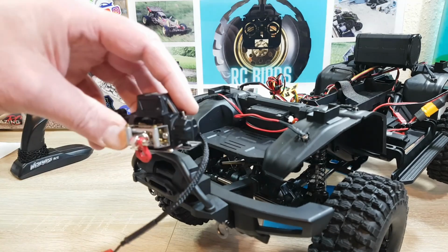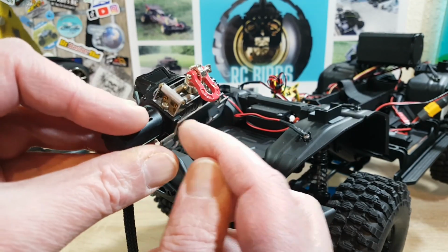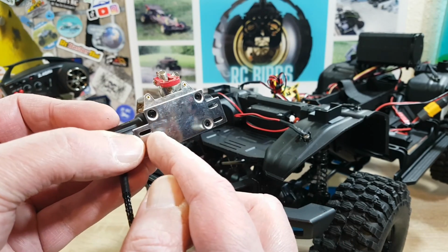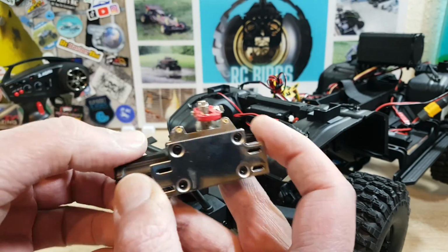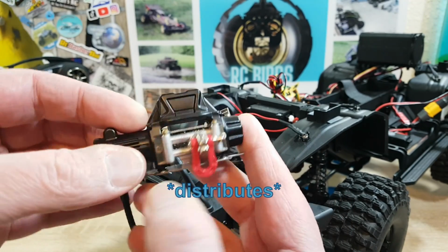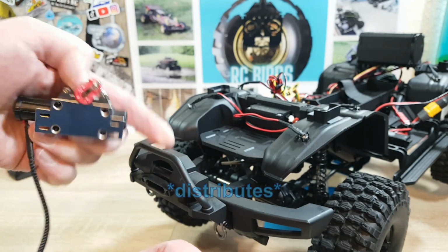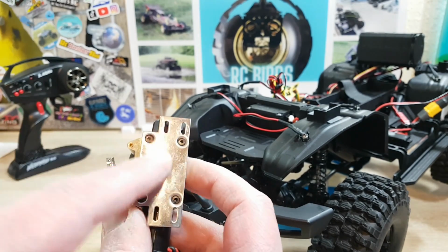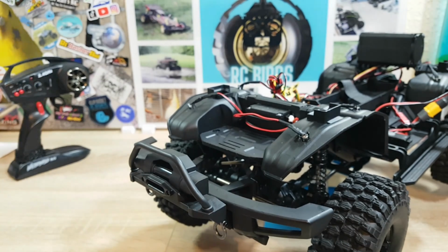on the winch. If you put on the winch, you can for sure use this for screw points and screws here, but I highly recommend to use this plate. It distributes the forces from the winch over the whole plate and is better to use. You can also use double-sided tape, but I think this won't hold for long.